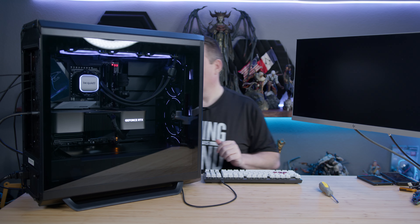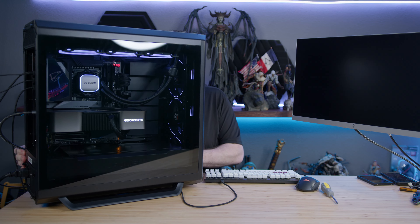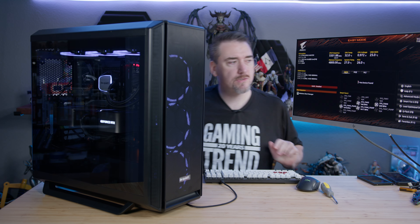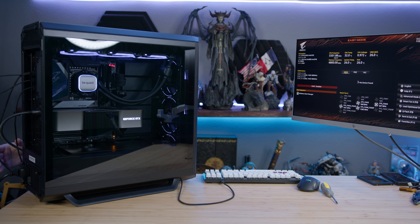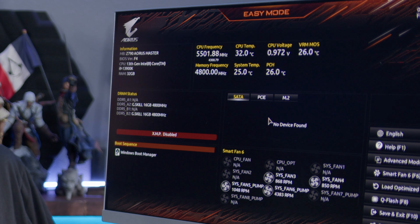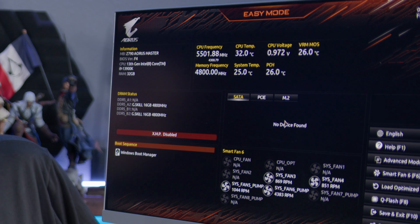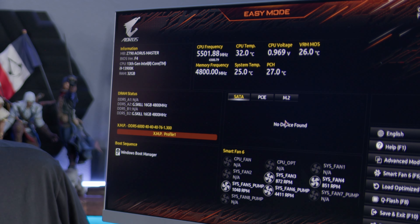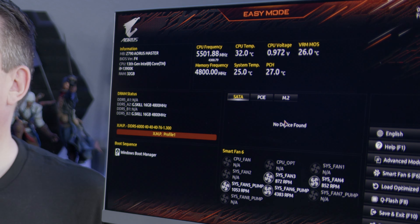While this boots, a couple of things I'd change if rebuilding: from the front I can see the fans aren't quite lined up the way I'd like, so I'll reopen and move those. It looks like we went right into the BIOS, which is great. Everything seems fine. I'll probably add another fan in the rear for additional airflow — this is dead silent so I'm not concerned about adding noise. There are plenty of BIOS revisions to update — I'm on F4 and they're at F11. XMP is also disabled, so we'll enable that: DDR5, 6000. Everything after that is loading Windows and running benchmarks, which is well past what I'm doing in this video.